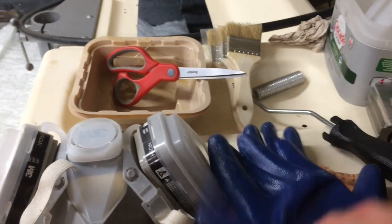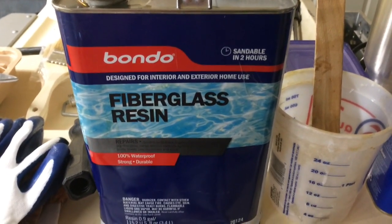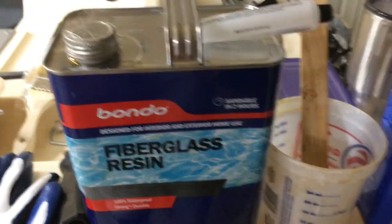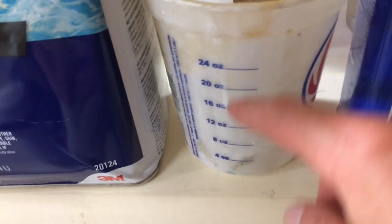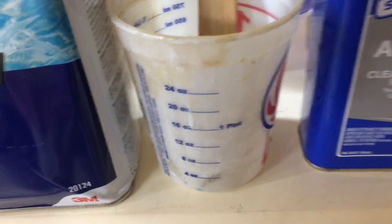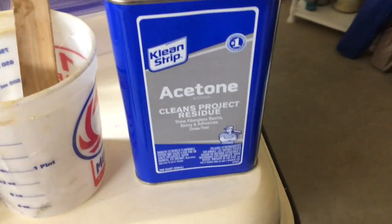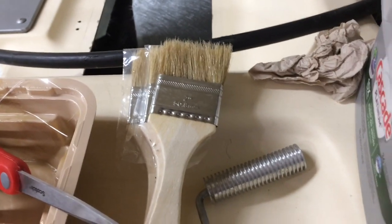This stuff is sticky and messy, so you need some type of protective gloves to protect your hands and keep that sticky resin off them. There are lots of different fiberglass resins on the market — this is the one I went with just to put a coat over the floor. It comes with a hardener that you mix in, so you need a good plastic mixing cup with a scale on it to measure how much you're mixing. You'll also need acetone for cleanup and some type of plastic container to put the acetone in to clean your tools — the chip brushes and rollers. These chip brushes are used to apply the resin down onto the chop mat.